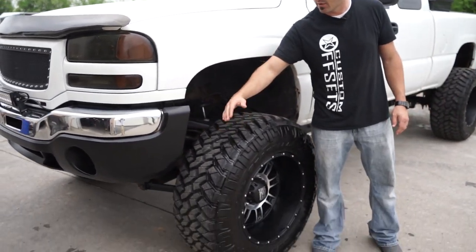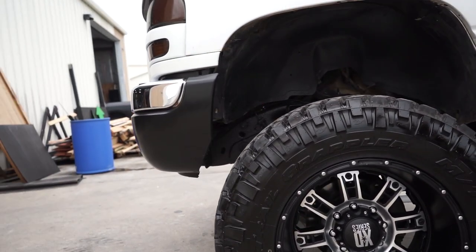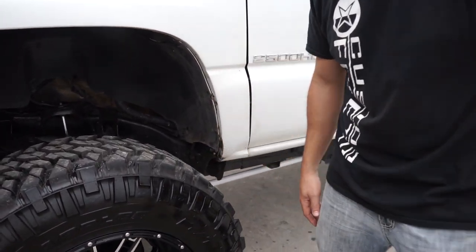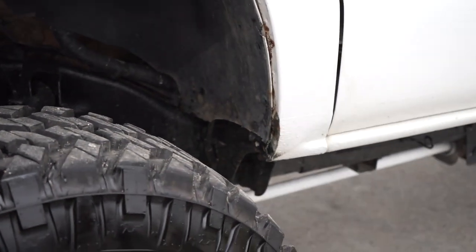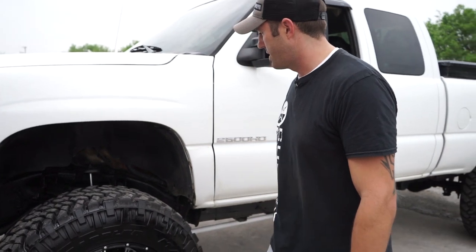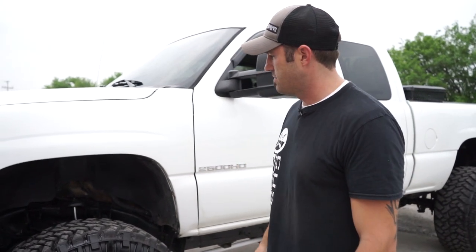You can see he did have to go in and take some of the bumper cover off. And then I'd imagine he had to take some of this back — basically sledgehammer, knock it back. Because otherwise when you go to crank, you're gonna catch the corner of these lugs and basically rip them right off, because it'll smack right into the metal.